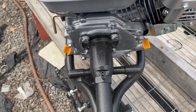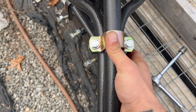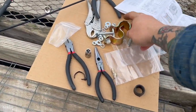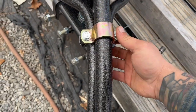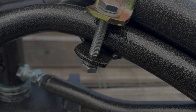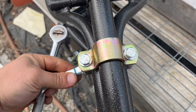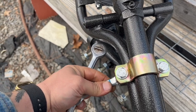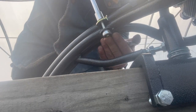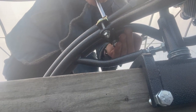Once those bolts are on, reinstall the clamps from before back over the newly installed shaft. It may be a little snugger now due to the slight gap. You'll need to put a 14 millimeter wrench on the bottom while you tighten down from the top. Alternate left to right so you don't put too much tension on one side and stress the bracket. For every turn you make on one side, do the same on the other side.